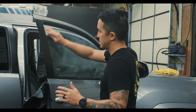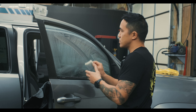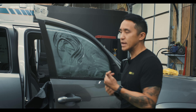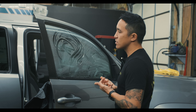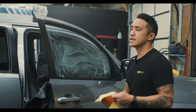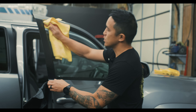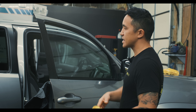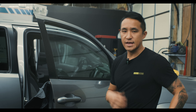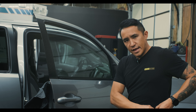When I'm cleaning this, I'm not going for the cleanest window possible — I just want to clean any dirt that might be on there. A technique you can also do is feel with your hand, feeling for anything that might be stuck on the glass, like tree sap or dirt. Some people might say you don't need to clean the outside glass, and you certainly can tint without doing this, but cleanliness is the name of the game. I like clean windows inside for sure and outside as well, especially if I'm going to shrink film — if there's a lot of contaminants on the glass, you'll imprint that contamination on the film.